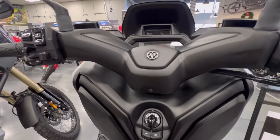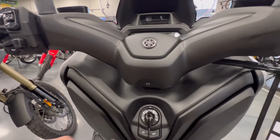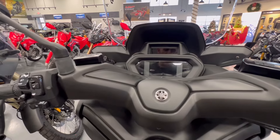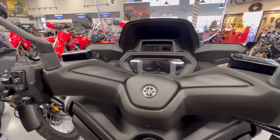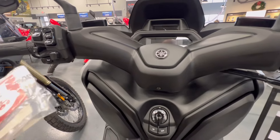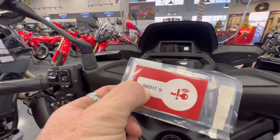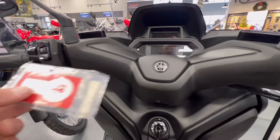These scooters have a recognized feature — anytime you want to turn the key on, you have to tap it and then turn the key on. What's going to happen is I'm going to press and hold the button three times. You'll see a light on the display, and on that third press you're going to hear it beep. At that point we start a recovery process. After that third press, I'm going to release, then press and hold again, and wait for the light to flash — in this case the first digit is five. Then I'll release, press and hold again, wait for it to flash six times, release, and so on.